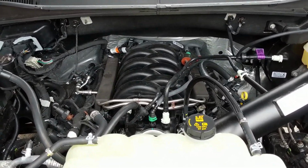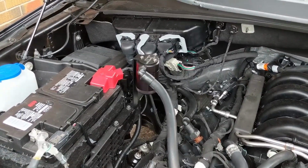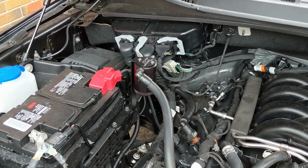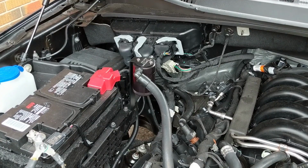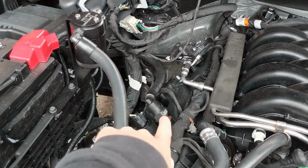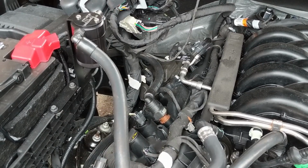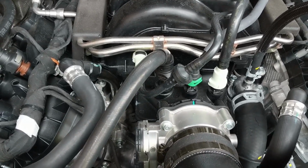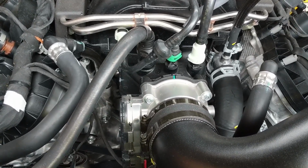Now, if you haven't seen my previous video where we installed the JLT 3.0 oil separator, I will link that in the top right of your screen, as well as in the description down below, so you can check that out. So here's your PCV connection on your passenger side, and the oil separator goes in between that, and then it routes itself back into the intake manifold, and you'll notice it's after the throttle body.